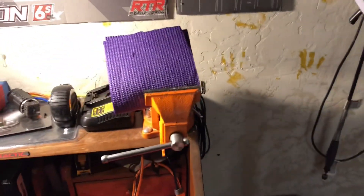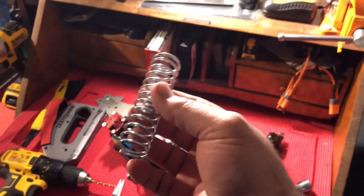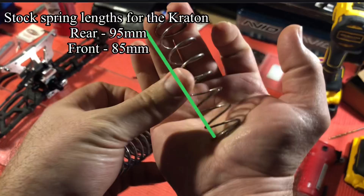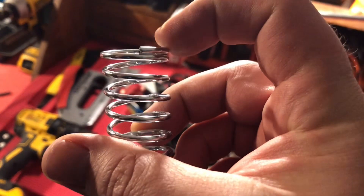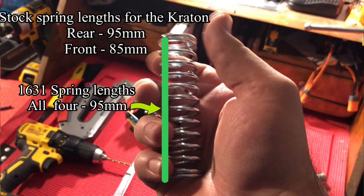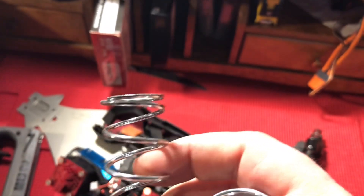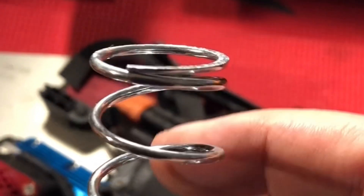The reason I'm explaining all this is because when you pick up the 1631 springs — again, I found to be a perfect length, perfect dimensions for these shocks — it's hard to find. A ton of research was put into finding the right spring that fits around these shocks. These ones do not have a shaved end; they have to be flattened. There are different terminology for the types of ends you get. If you take a look at a free-roaming spring, you can see how it's really thin and flattened out — that came from the manufacturer this way.